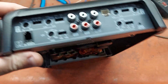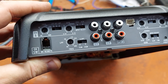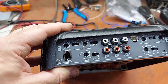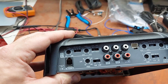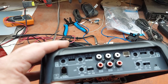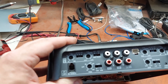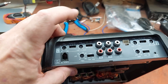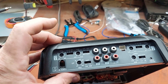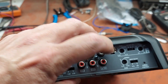The only other thing I could complain about is that the bass boost is centered at 50 Hz, which I'm not a fan of. I think it should be around 35 or 40 Hz. Rockford Fosgate for years used 45 Hz, which I think they still do. PPI sort of came in underneath them — they had a programmable parametric EQ using buttons. I had a PPI PC 2150 the other day; it went quick. I remember the Q selection where, depending on which button was in or out, you could do 36 Hz, 40 Hz, 44 Hz, and one other option.